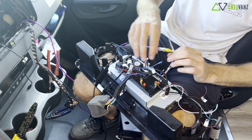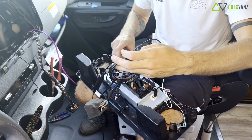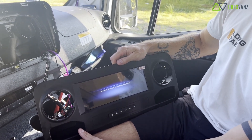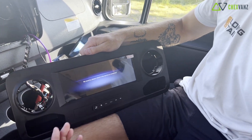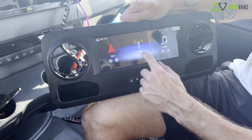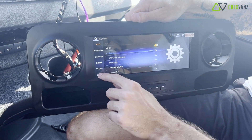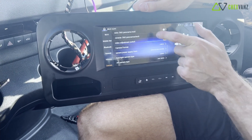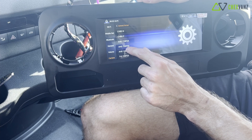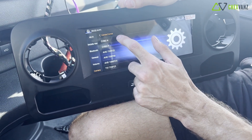We're going to plug our ground back in now that we have everything connected, so we hopefully don't set off anything and have to do a reset at Mercedes. Once it's booted up, think of this like a tablet or phone. Tap the screen, find the home button on the upper left, scroll over to settings. For camera settings, our camera format needed to be set to CVBS — it was originally set to HD 720p25, which does nothing at all when you go into reverse on the vehicle. Selecting CVBS works for us.